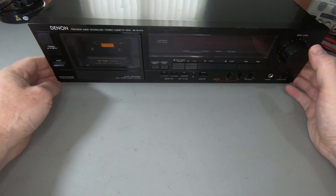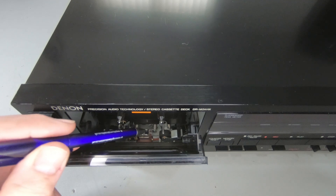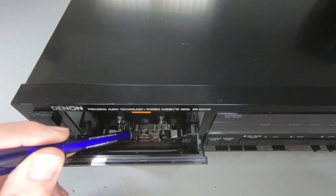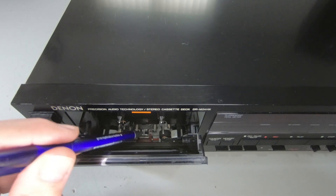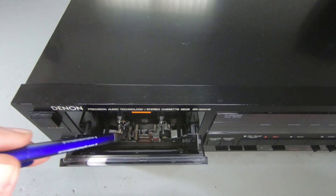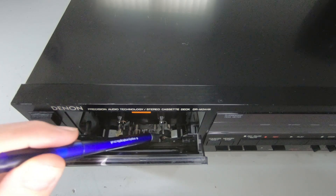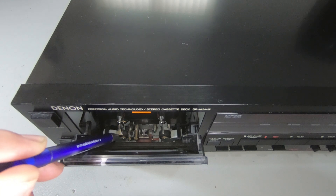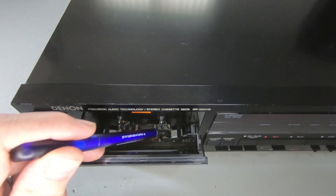If we show you inside, we can see our cassette head in the middle there. As I said, this is a three-head deck, so you've got the erase head and then we've got the record head and the playback head together on this block here. But this could just be a two-head cassette deck and still have the dual capstan. The first capstan is here — this is always in this position, whether it's a dual or a single capstan. The second capstan is here before the head, so you have one before the tape head and one after.